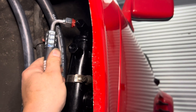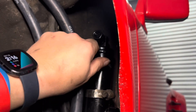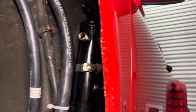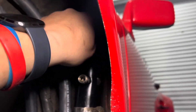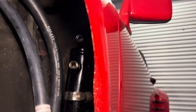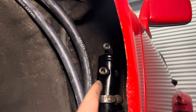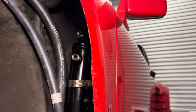That fitting is basically our limitation, so that's about as high as we can go with the dryer. On the really nice ones — there you go, you hear it — this dryer actually had a vacuum in it so it wasn't sucking up air. This lower port is way too far down, so we're going to have to move that hose. In the interest of time and not leaving this dryer open to free air for long, we're going to get those installed and grab some O-rings.